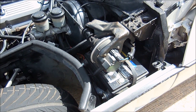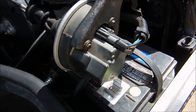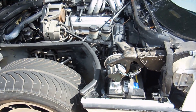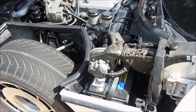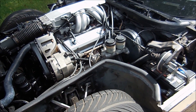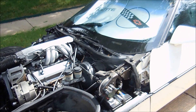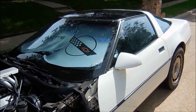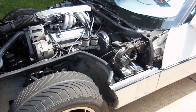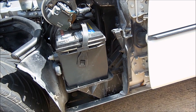A charge seems fine — it's just that the battery might not hold a charge. This battery is from 2011, and most batteries last about four years, so it might just be time for it to go. I'm going to take it out, bring it home, charge it up, and see how long it lasts. Honestly, I don't expect it to last since the car can sit for 12 hours and die.